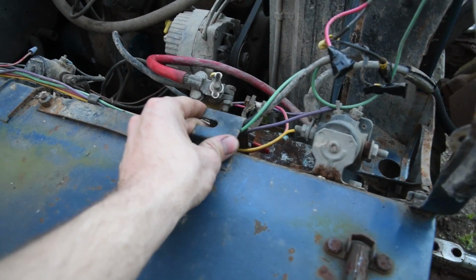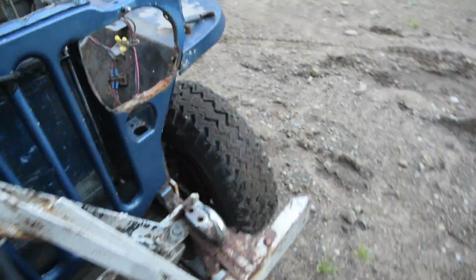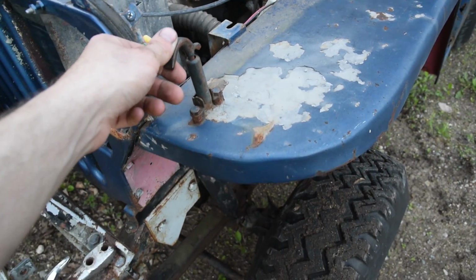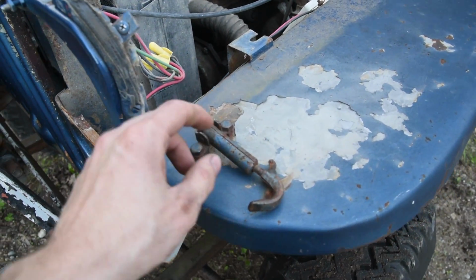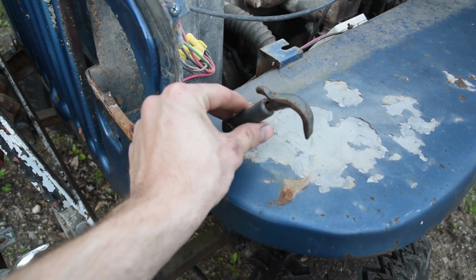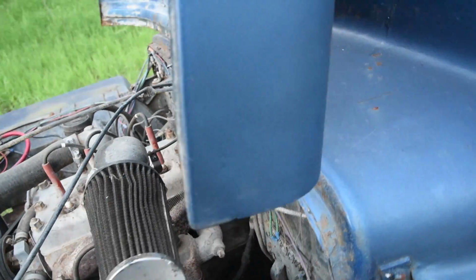So a civilian Jeep does not have that, and then the World War II Jeeps also had these little reinforcement brackets here. Same thing right here, spot for the headlight. Now on this World War II Jeep, these are not the correct hinges, obviously. But a good way to tell if it's got the original hinges is the CJ2A hinge is round right here on the bottom. And on a World War II Jeep, on the inside, it's going to be a flat ledge right there. So it's all the little details you've got to really start looking for. So let's go ahead and shut the hood here.